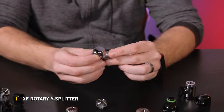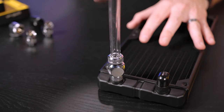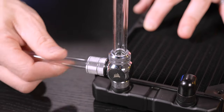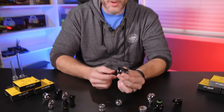This is where you can get creative with the XF adapter. This is basically a Y adapter — it has a built-in rotary and is already G1/4 threaded, so you can put it into anything with threads, whether it be a radiator or a block. This allows you to spread off into a parallel loop where some flow goes to a CPU block and some goes elsewhere in your system, and you'd use the same fitting to bring those tubes back together wherever they meet again.